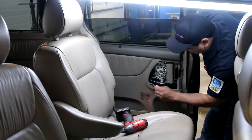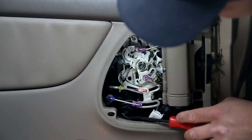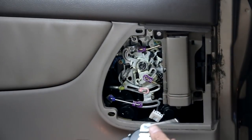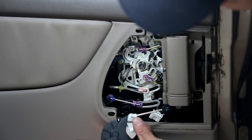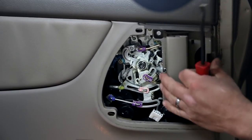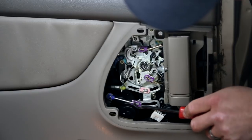This mechanism right here — we're going to zoom in and I'll show you. This is the part we're concerned about right down here: it's the release actuator, the one that has this bar connected right here. This is a Toyota part, and when you pull the inside handle or the outside handle it'll pull on the release mechanism. When you push the button, this is what pulls it.